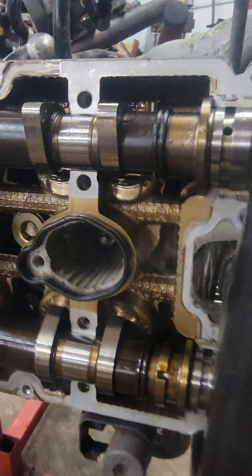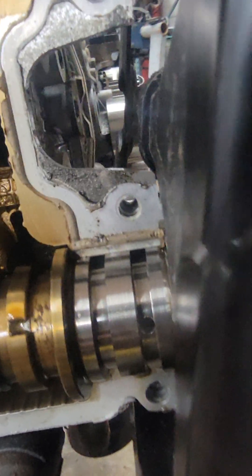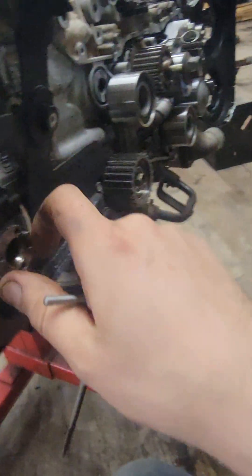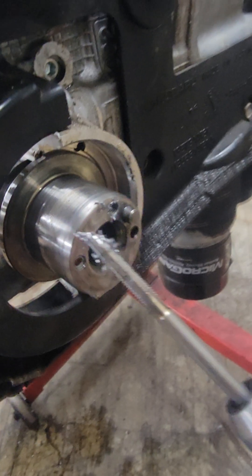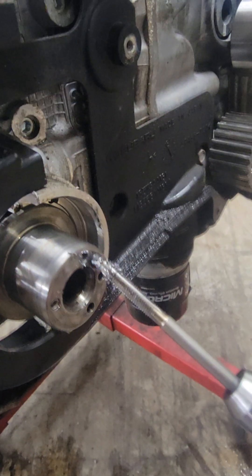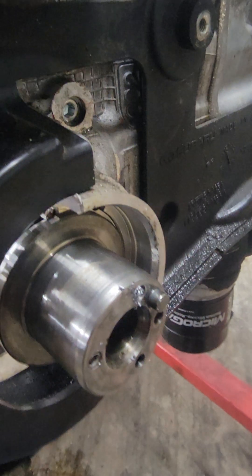To get to this point, all I've done is take the covers off the front cam cap so I can get to these oil feed holes, because this is what you're going to use to clean out the hole afterwards. There should be one on this journal as well. You turn it a little bit to get to the other hole to clean it out with compressed air or brake cleaner, whatever you have handy. That's why you need to pull the cam cap off — that's the threading dust from threading this hole, and you don't want that to end up in your motor.